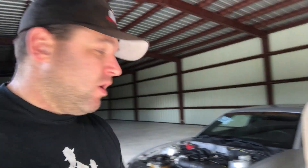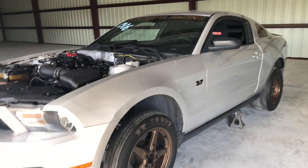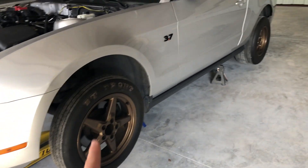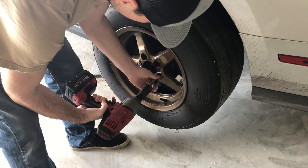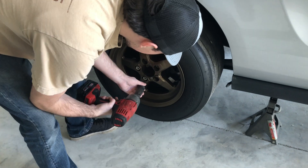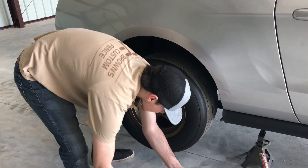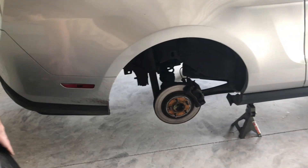We're going to start by having Matt go ahead and pull the rear end off from under the car. We're going to get it jacked up on four different jack stands and start pulling off all the wheels. We're going to continue pulling everything off so it's fully disassembled and we can start installing all the new suspension. First thing — we got her up in the air on jack stands so we're a little safer. First thing first, we're going to remove the tires, wheels, and lug nuts so we can get to the suspension. First step for doing your rear suspension: back wheels and tires off.